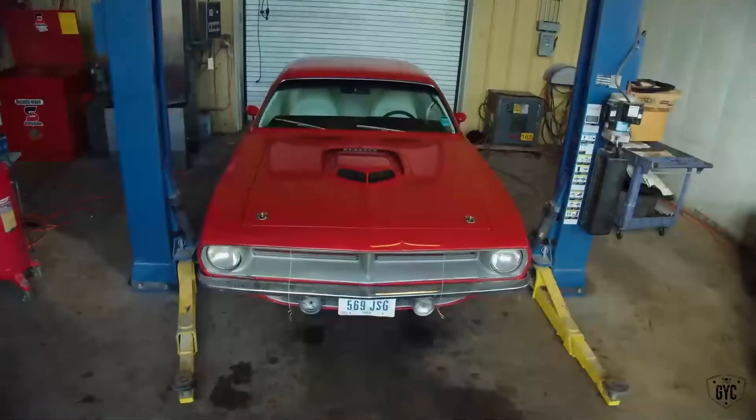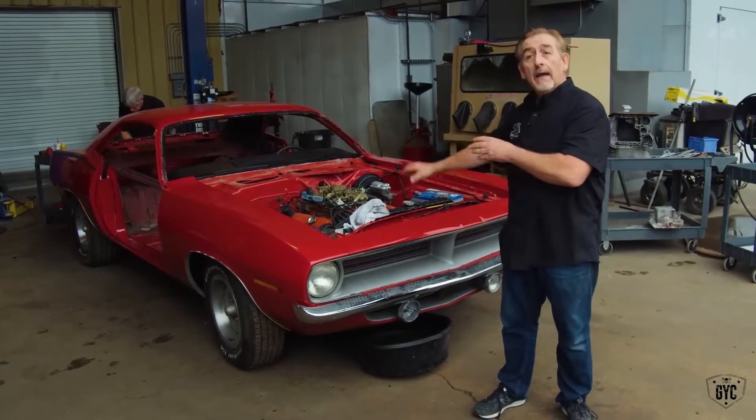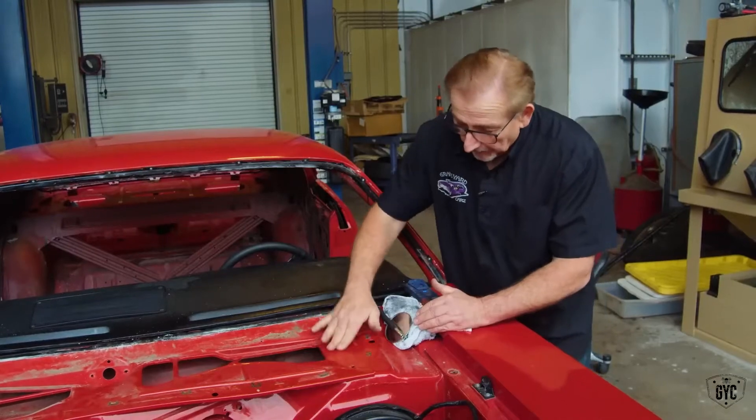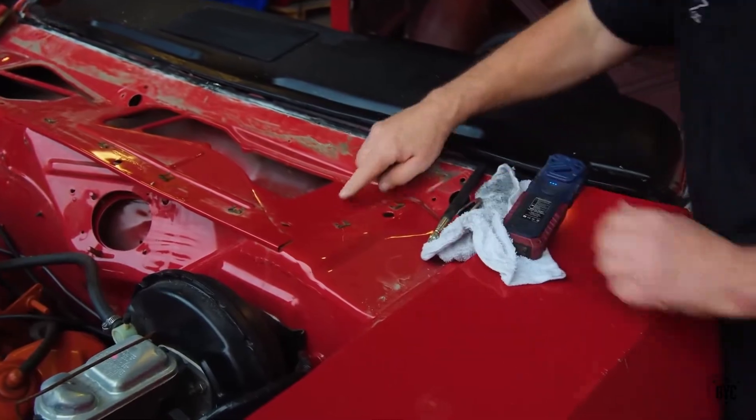While it's on the ground and the hood is off, it's easy to see the last eight digits of the vehicle identification number stamped into the upper cowl. That was one of the so-called hidden numbers that Chrysler had — they're supposed to match the title, the dash, the door, and the core support. Looking at it from the outside, the numbers actually match the last eight. Here: 'B' is where the car was built — Hamtramck, Michigan. '0' is 1970. And this is the serial number of the car.